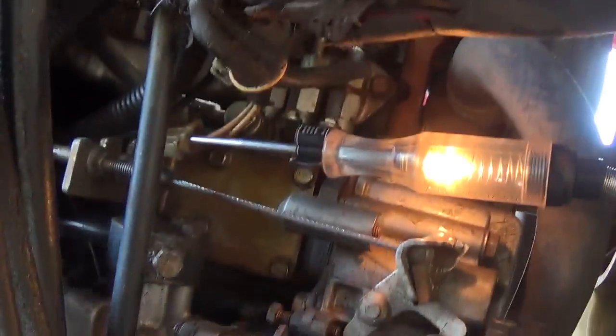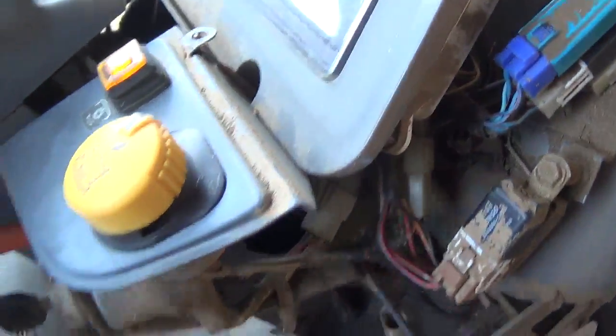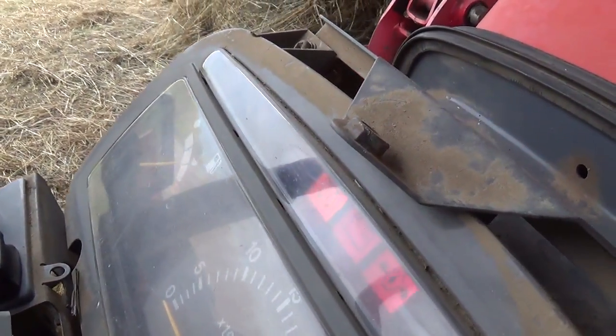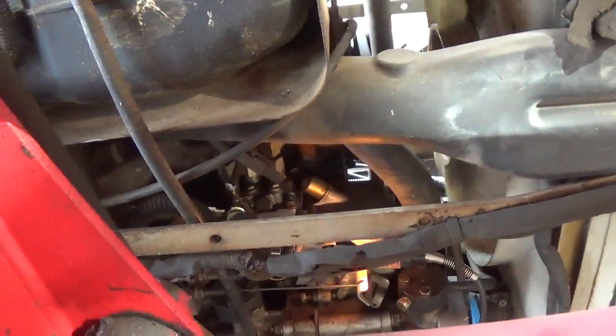I'm on the harness side — you can see our test light is bright, but the connector is unplugged. Let's crank it and see what happens. Now to shut this down, I'll need to plug that back in, otherwise it will keep running. Do we need glow plugs for this thing? There's a little light there — okay, I see it. We'll crank it again. Nope, still a crank no start. So this is more interesting than a bad fuel pump shut-off coil — we'll see where we go from here.